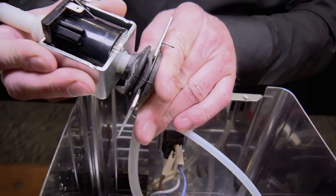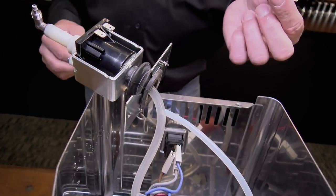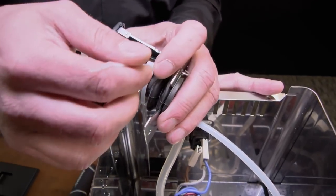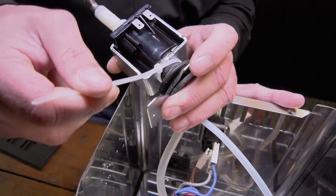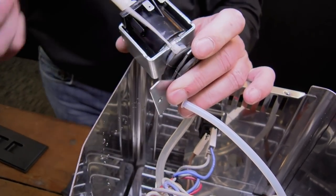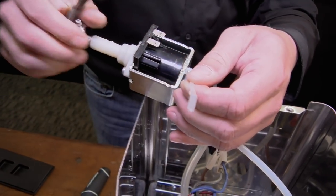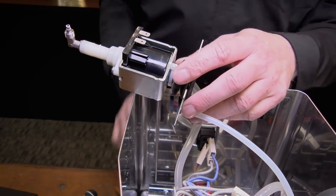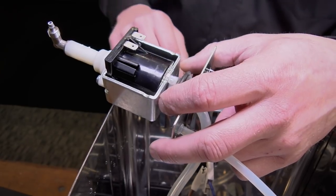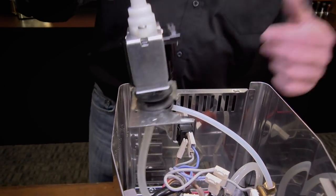We're going to slide this collar up and around and push it onto the neck it just came off from — that white neck right there. Because we broke the glue free, we use a zip tie to go around that neck. Get it started — I like to leave the zip tie tail towards the front so I can cut off the excess. Pull it snug going back and forth, as tight as I can. Then get the little clippers — be careful because these things will shoot off if you're not holding them. Cut off the excess. This zip tie prevents that rubber neck from coming off the pump, and will make sure the pump never comes out during movement of the machine.